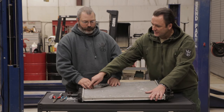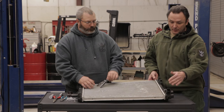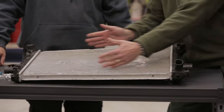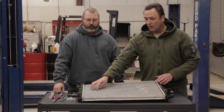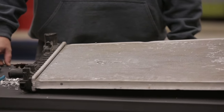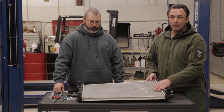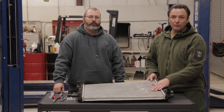You would clear out the other side and do the same thing there. Basically how a radiator works is the fluid comes in on the plastic side, travels through all these flattened tubes, dissipates all the heat, and comes back out through the other hose. All we're doing is blocking the rows where that bullet hole was. We're losing a little bit of cooling effect, but that fluid can still flow through the rest of the radiator. This vehicle can be fully functional by simply using the Leatherman. Patching it can be quickly done once you get access to it — this vehicle is back out and ready to get back on the road.